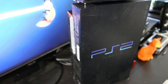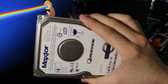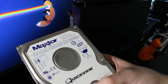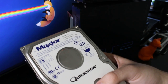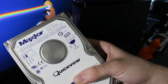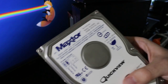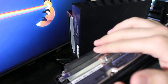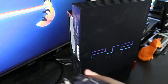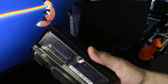So I started looking into it a bit more, and I wanted to get something more than 250 gigs. You can find IDE drives for free in old computers, but those might be 80 gigs, 120 gigs, or even smaller. If you want to pay for more, IDE had its limitations not only with storage but also with speed. And if you get a bigger IDE drive pushing about 500 gigs, they get expensive because this technology is just so old. If you want a one terabyte drive, you're going to have to go SATA. For the PS2, you could get some IDE to SATA adapters and plug in a 2.5-inch laptop hard drive, but I don't like messing with adapters, and the hard drive would flop around in the PS2 if you moved it.